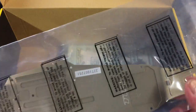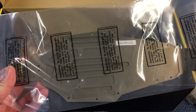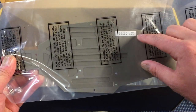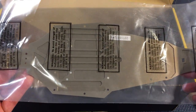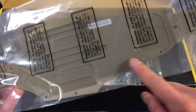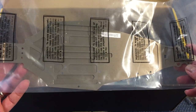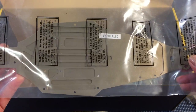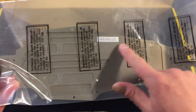On to the chassis. The chassis is obviously different — you can now run the battery transversely. One of the weird things about the 2.0 is it was really meant for saddle packs or square packs; if you wanted to run a shorty it had to be inline, and you couldn't mount the ESC up front. Now you can run shorties inline or transversely. There's nice milling here, though the 2.0 actually had two chassis variants — the stock heavier unmilled one, and a replacement with more milling that was about 10-12 grams lighter.